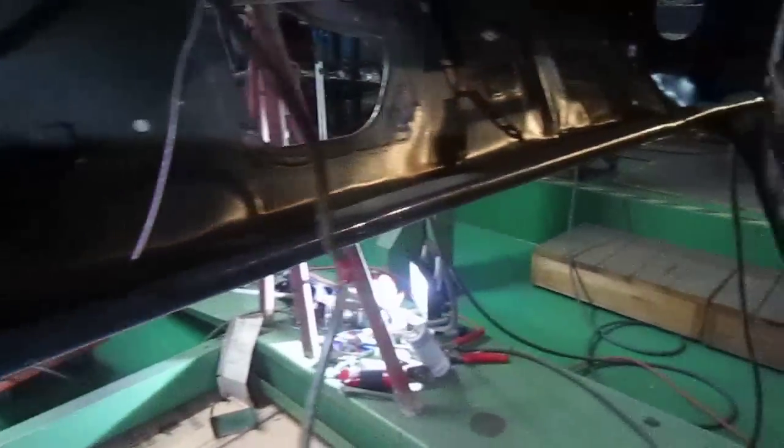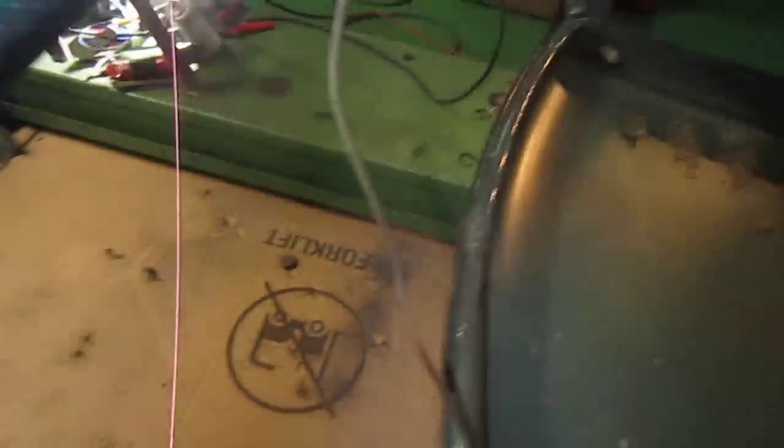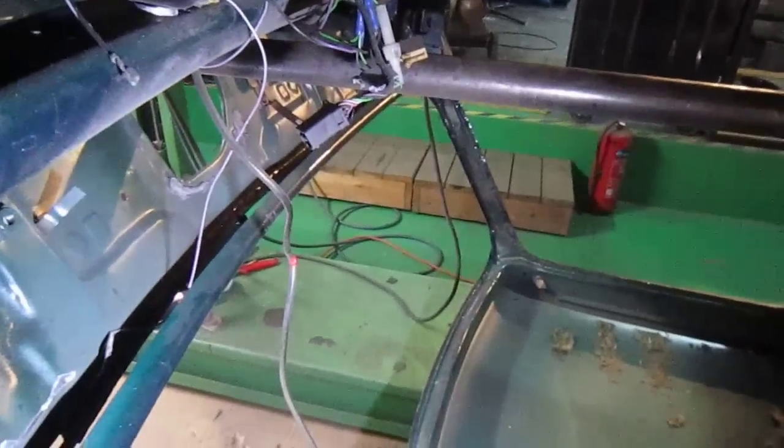It's the other side — sorry, my memory's going. I've just got back from Graz, it's a 100K round trip to go and pick up these mini spares. So I've cut a piece out of here as you can see at the front, and I'm now seriously thinking about this top dash rail — the car's upside down obviously. I'm seriously thinking about taking it out and putting a new one in, which you can buy from Mini Spares, because if you look inside there you can see how bad the rust is. Maybe I can get to it and clean it, but the problem is where this fold is. It just looks like surface rust, but I'm not sure. The other end repair hasn't turned out as well as I would have liked, so maybe I'll just put a whole new rail in and be done with it. It's quite a big job, but the car's down anyway.